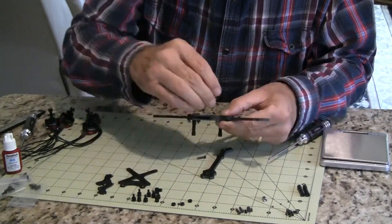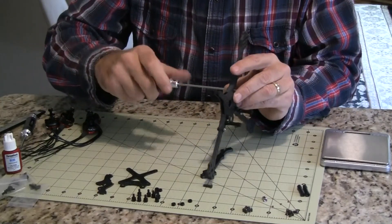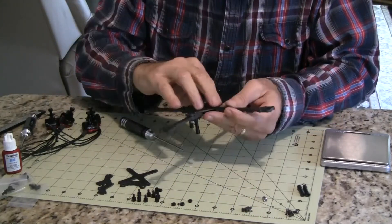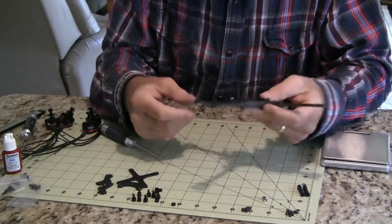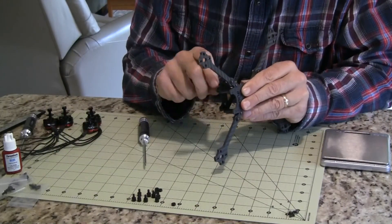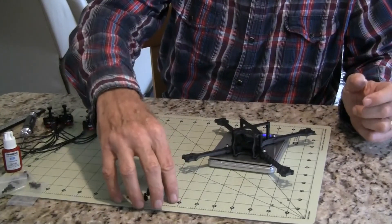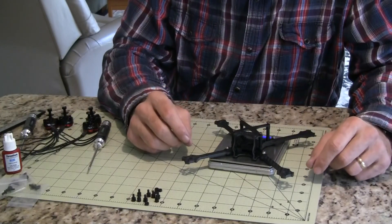Overall, I'm very happy with this build. It's going to be extremely light — the frame is 60 grams and the dry weight should end up around 230 grams. People might say the arms are too lightweight, they're only 4 millimeters thick and 7 millimeters wide, but it should go through the air quite fast, and the replacement arms are four for $14. In the next several weeks I should post another video on the completion of this build and the first flight. If you have any questions, please leave them below. Thank you for watching.